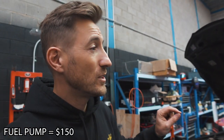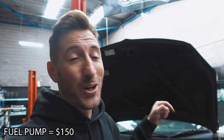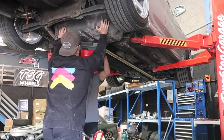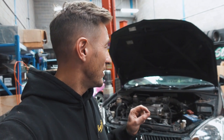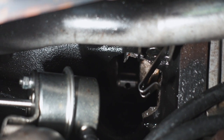And of course with fuel injectors you also need to upgrade your fuel pump. Unfortunately that is a hard job on these Lancers because the fuel pump is on top of the fuel tank and you have to remove the fuel tank in most models to get the fuel pump out — which is kind of a mission if you don't have a hoist. It can be done with a bit of elbow grease but it's not the easiest job. That said, you definitely need to do it if you don't want a viewing window into the side of your motor.